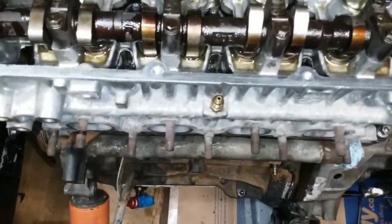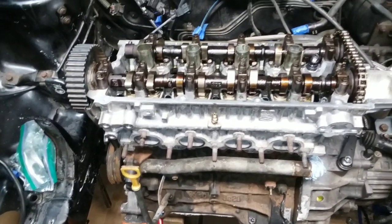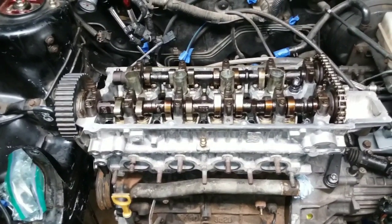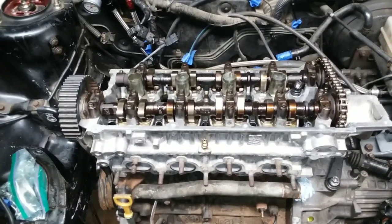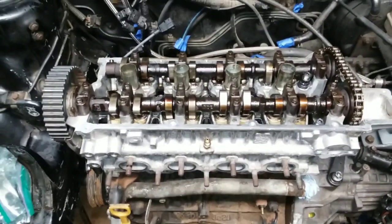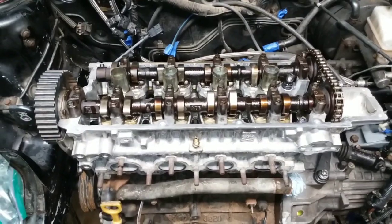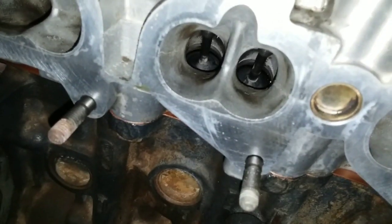Cams put in there, which are just stock XD cams, which are actually a little bit bigger cam than the ones that we had in it. The Beta 2s are actually a little bit bigger than the 1.8 in the stock 2.0 cam in the front. So actually, these are a little bit bigger, not much. They got the bigger ports. Much bigger ports, especially the intake. Look at that. Way bigger.